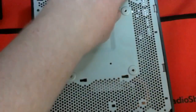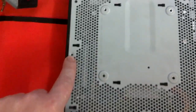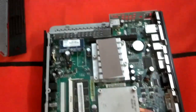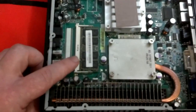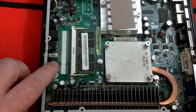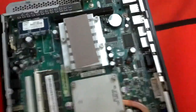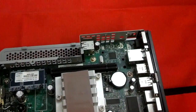There are four more screws in here - two down here, one there, and one there. Then this front side just kind of lifts out. This is really easy - not a lot of effort to get this open at all. And then you can see the flash module and the RAM. There's a spot where they could have put another socket - you could have put maybe two gigs in there. There's your passive heatsink for the processor, and probably your north bridge and south bridge under there.